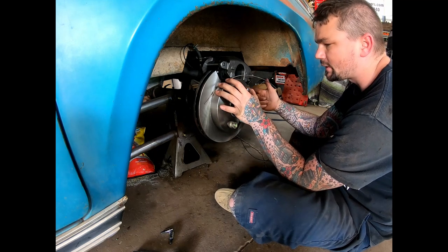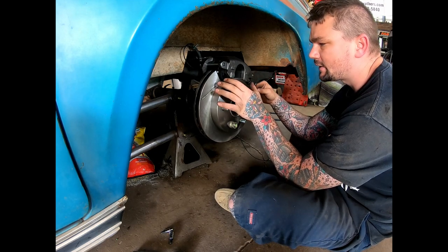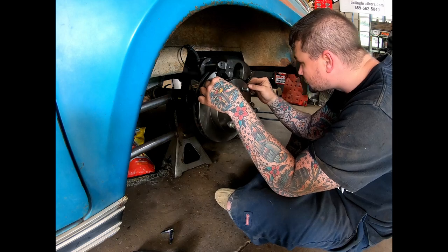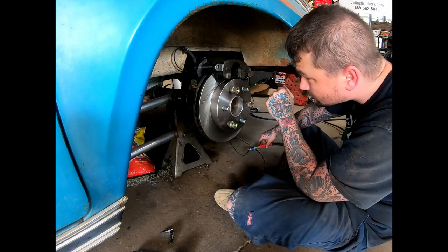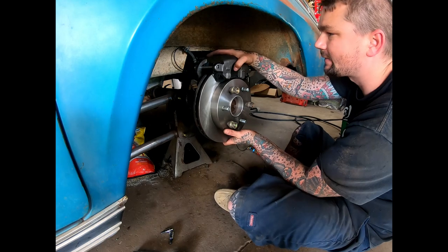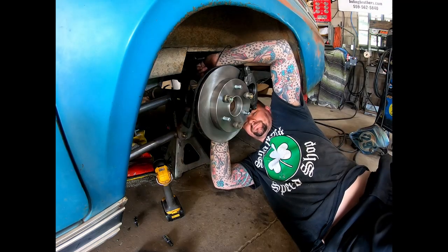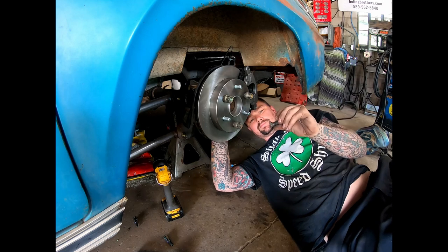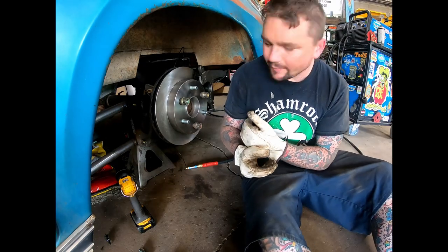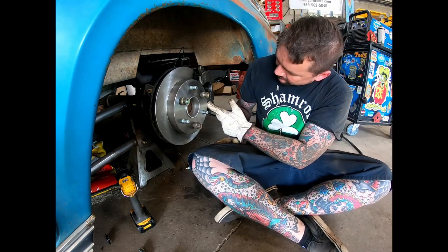And then I'm gonna see what we're looking like on the back side. We'll make sure we can get the studs in and out, since that was the whole point of this. And if everything looks good, we'll tack it on. So now that has that rotor, I got my gap right there. So those studs will both come out. The top one's very tight, but it was just like that on the other side. The bottom one's easier to get out. And we got our gap set here.